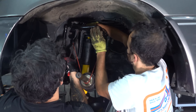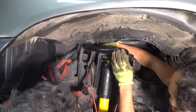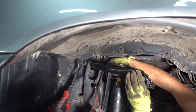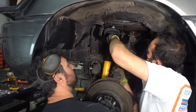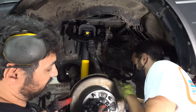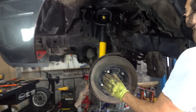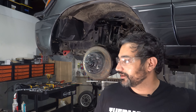These have self-locking nuts so they're going to be a little bit of a bear to get close, but once they're in there, that's nice. All the caster and camber adjustments are in the upper arms here, so I'm going to set them essentially in the middle and then get the thing over to get aligned.